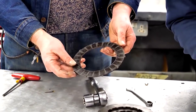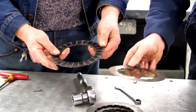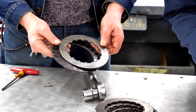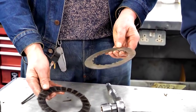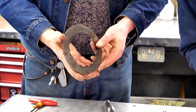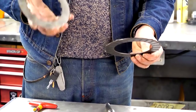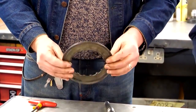Typically, the drive is affected by these little dogs which fit into slots in the chain wheel. They take quite a pounding and you quite often find them very worn or even broken off altogether, but these are quite good. There's quite a lot of corrosion stain on these plates. A thing that very commonly happens when you get clutch slip is people think, oh these friction plates are obviously worn, replace these — but you've actually got to watch out for the plain steel plates. When the clutch starts to slip you get a lot of friction, it gets very, very hot, and these can actually distort and get out of flat. Once that happens they form almost like a spring, causing drag when you operate the clutch. So if you put in new friction plates but use the old distorted plain plates, you've given yourself a huge problem. It's always a good idea to put them all together and make sure they're still flat — if there's any sense of them rocking, you've got a problem.